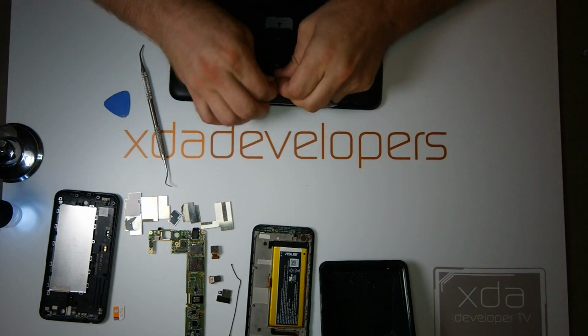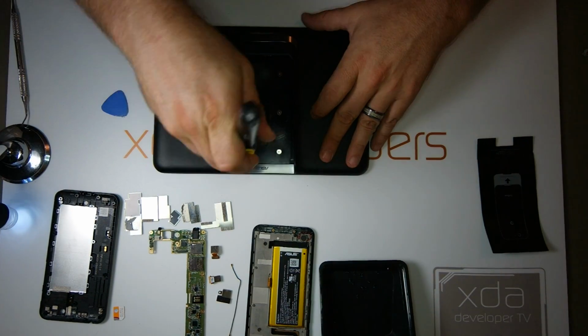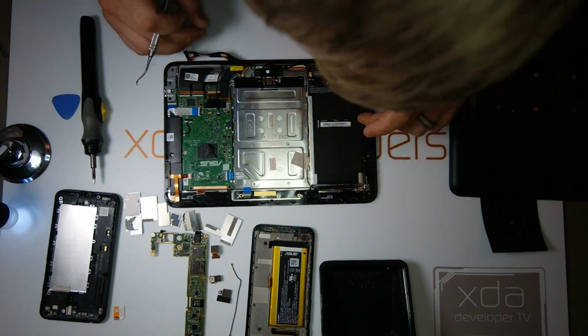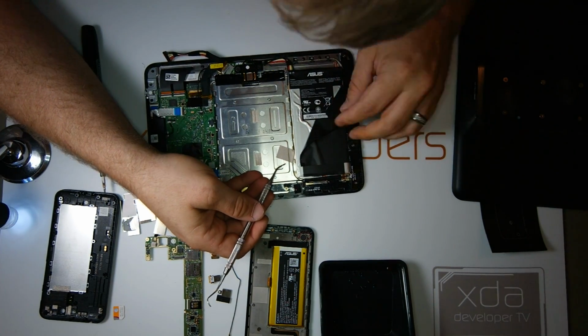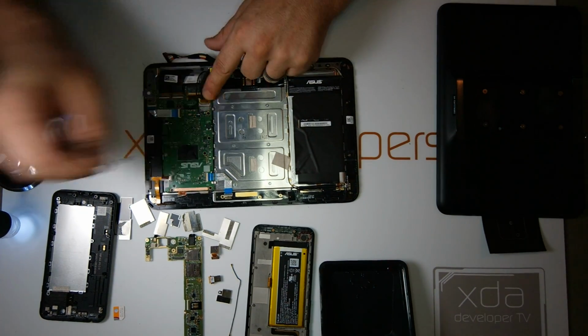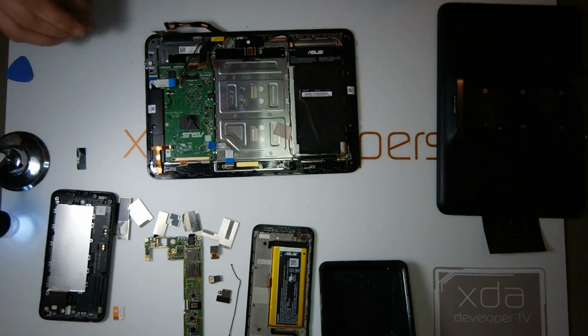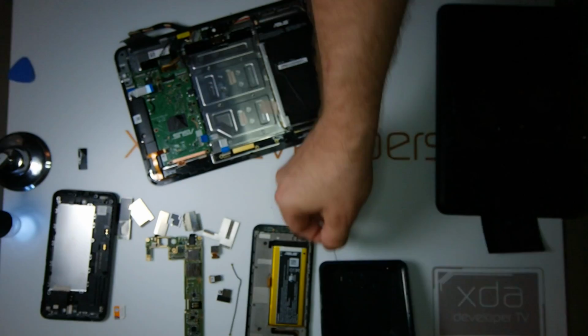The tablet, aka PadFone Station, exhibits an entirely different style from the phone, and I'm talking about everything except the external materials. The external screws are hidden, the type of screws used are Phillips Type 0, and the screws are of an entirely different style, utilizing their sheer girth rather than numbers to secure the back panel to the station. The board itself is secured by screws, and there's even a security seal which you can get under with a needle, as I've shown previously in videos.